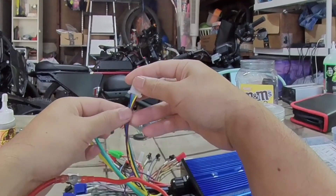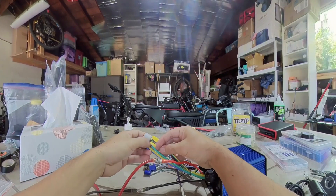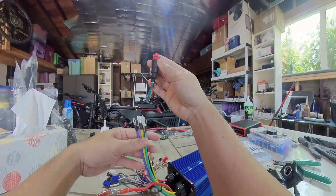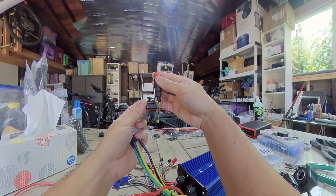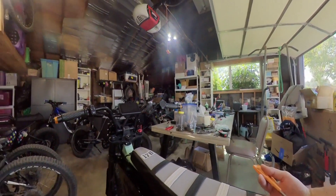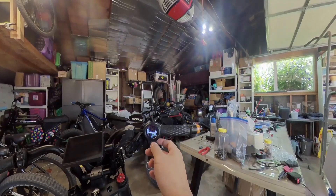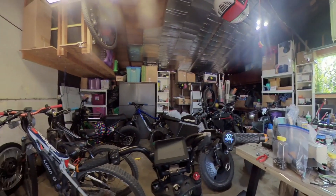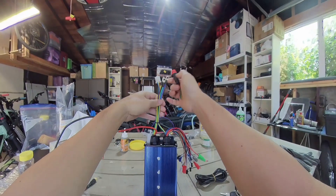Find your hall sensors — it's typically the one with five wires. What I typically do is basically join this to this, and it's just color matching. It's pretty easy, except the white won't be matching with anything. This is my newest build, and this is what I mean by the other LCD display — this one tracks miles per hour as well, and I have this on my newest SuperSemi 3RX.